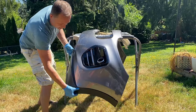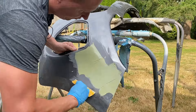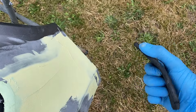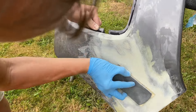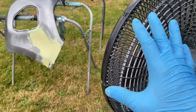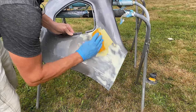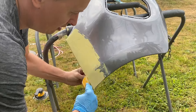This bumper cover is nowhere near ready to be painted, so let's get it there. Besides the repaired crack, there wasn't really any distortion to the plastic in this area, so this repair only required a thin coat of Bondo just to fill all of the minor imperfections. Whenever I work areas such as these, I don't like using flat hard blocks — instead I would use one of these foam blocks that are pretty flimsy. If you look at it even in a relaxed position, it's got a slight curvature to it, and just by applying pressure in the right areas you can shape this block to your curves. Whenever I do Bondo work, I always have a fan running nearby — this way, all of the dust gets blown out of my way so I don't get any of it in my eyes, my clothes, and I'm also not breathing any of that dust.